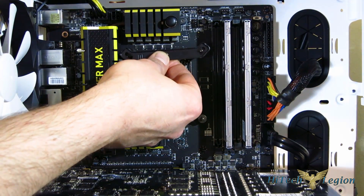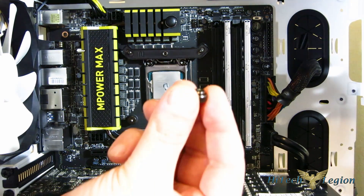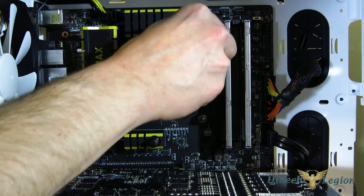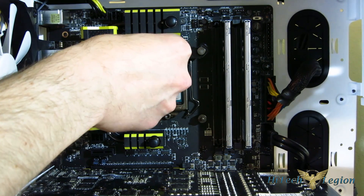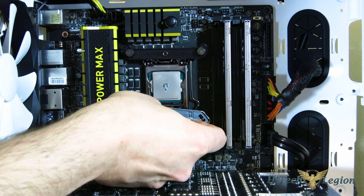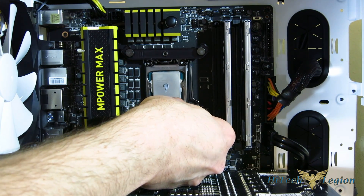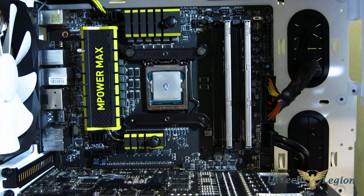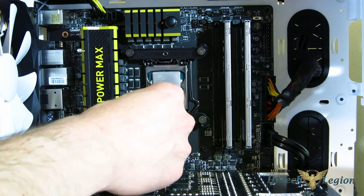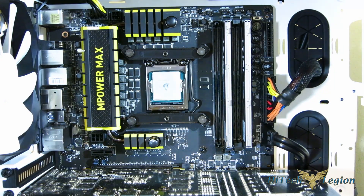Next, your crossbars go across top and bottom. Make sure you use the center slots if you're doing an 1150 or inside for 775, and outside for 1366. Small nuts go right on top. Once again, they do have a stop. Repeat on the bottom again, making sure you want the bar closer to the CPU. And with that, the mounting kit is completely in place.